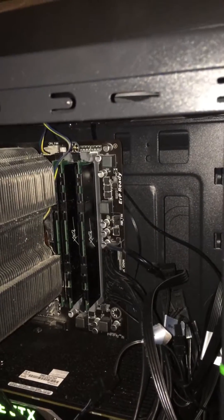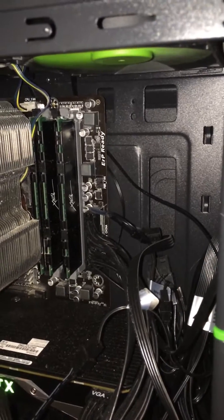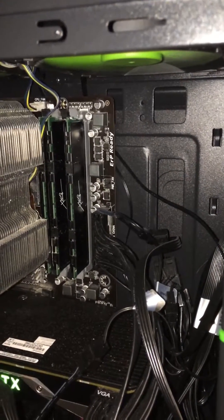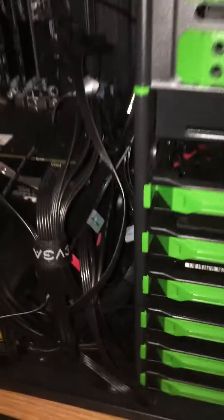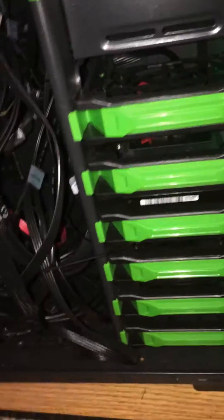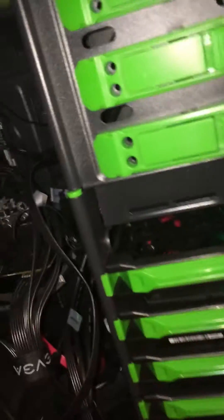I just decided out of nowhere to do something with the RAM, and it turns out — as I later found in a forum — they also said to overlook your RAM, and I was like, maybe that's why that worked. So all you have to do is just unhook it and interchange it, pull one out. Obviously if you only have one RAM stick, you might have to get a new one, but normally on average you have two. Just take out one — you won't have the extra four gigabytes of RAM or whatever, but if it's bad, then it doesn't really matter.